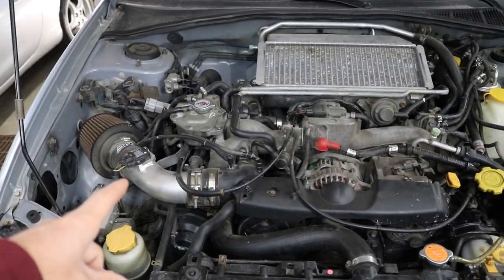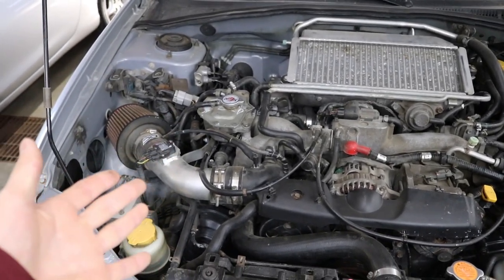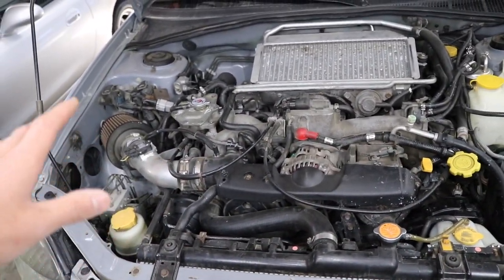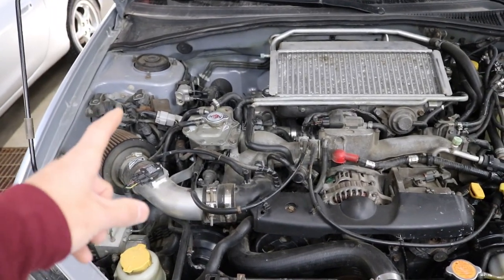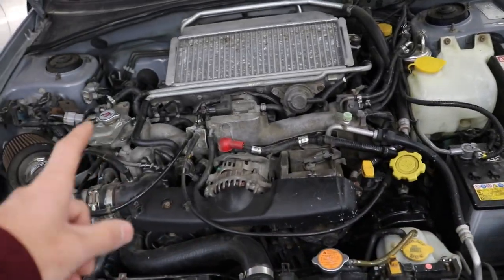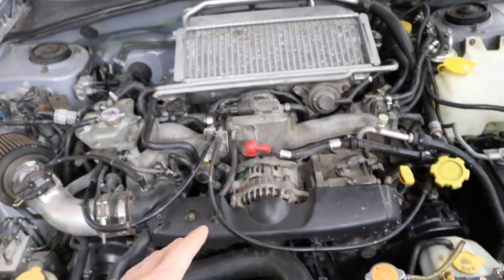To get started up top, this car has a cold air intake which I'll be reverting back to stock most likely, because this car is on the factory tune and I don't like running aftermarket parts that affect drivability if it's not tuned for it. First thing we're going to do is get the cold air intake pipe pulled out. We're going to remove the battery and remove this belt cover with your cruise control and throttle cable linkage.